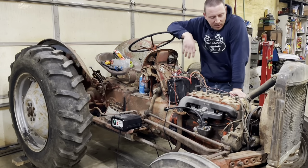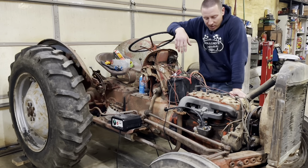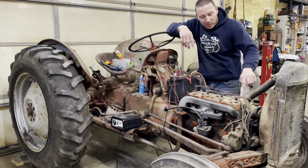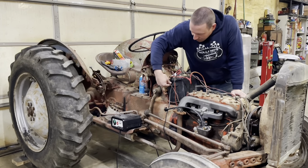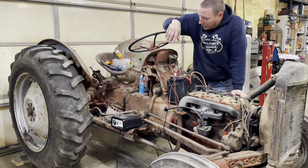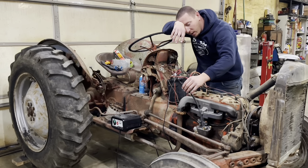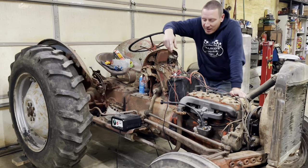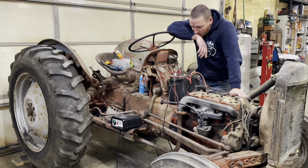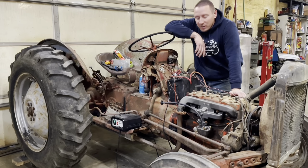Well, fellas, I reckon it's time where we find out if we've got an engine or not. I've checked that we do have 12 volts to the coil, hooked the battery up. I've hooked the choke rod assembly up, which whoever designed that was a pretty sick individual. I think I have the carburetor full of gas, as much as I can get. I also have some laughing gas we can just snort up into that thing. These usually start pretty good, so I guess we'll find out together.